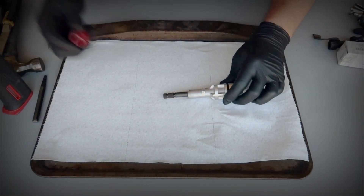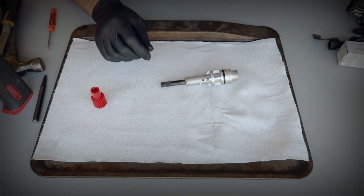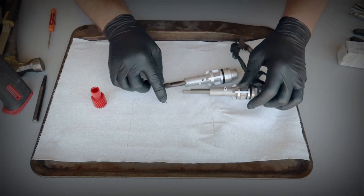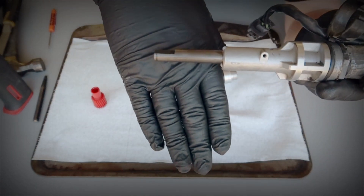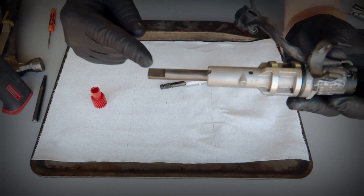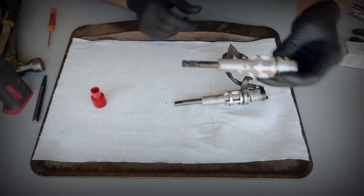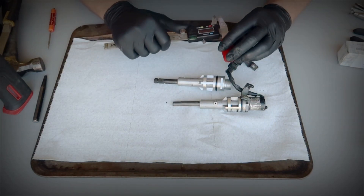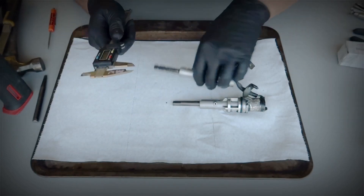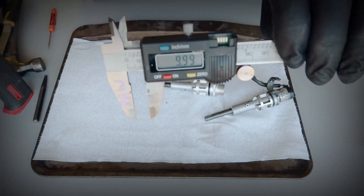What we're looking at now is the shaft has a knurl on the end — it is a complete circle on the end. If you remember back to the RB25 speed sensor I took apart, it has a half crescent moon shape on the end. You're gonna have to transfer that notch over to the new sensor — don't get scared, it's pretty easy. There's just a couple measurements I'll share. I personally used a Dremel tool and ground it down, then used a hand file to finish up and get that true 90-degree elbow. Leave a little bit of material so it fills into the knurl spots of the new sensor shaft — you don't want it sitting in there loose.